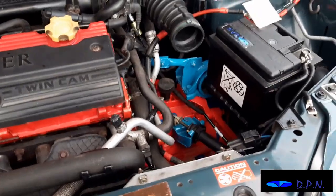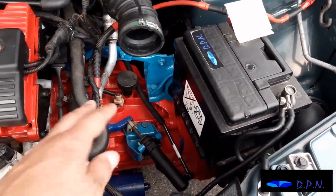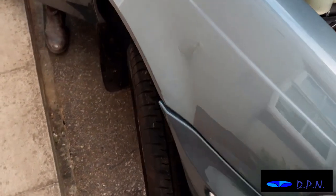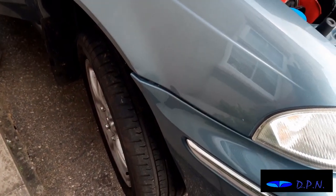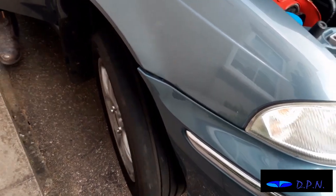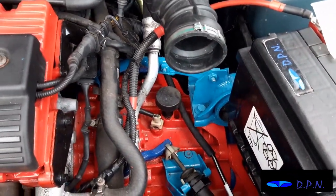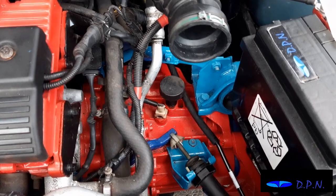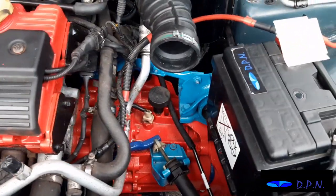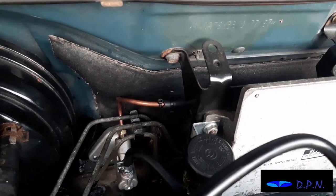Right, so we started the engine up. We've got the battery there temporary, so we can check that was all moving okay. What we're doing is putting it into first gear and reverse, and just checking as we let the pedal up that the wheels turn, so we know that there is drive being disengaged and engaged. As you can see there, the wheels moving. And then if I bring back, just do it one more time. So yeah, you can see there that the clutch is being moved in and out, and we're getting drive and losing drive.